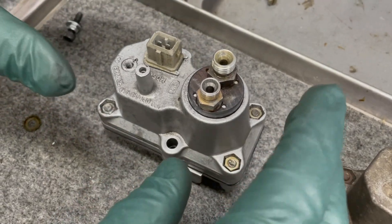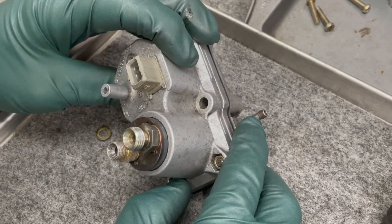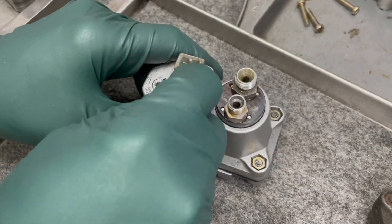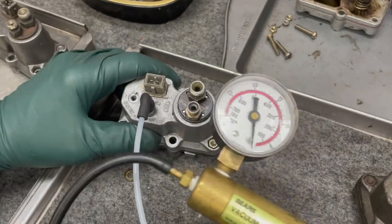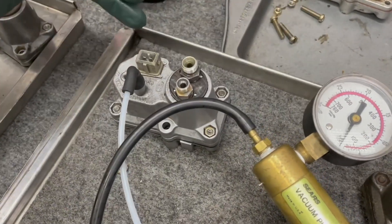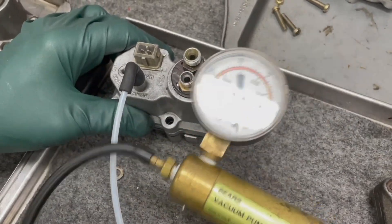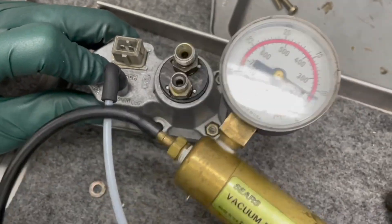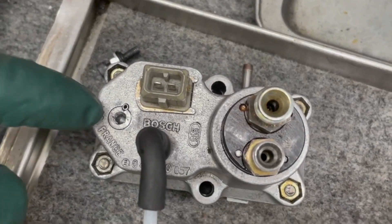My sidekick decided to test this. Remember, in single diaphragm units like you see here, this line down here is to vent and this line here is manifold vacuum. So we applied some manifold vacuum and watched — it's not holding vacuum. That means we've got a leak in this housing, because this should be sealed. We put a new gasket in, everything else is tight, yet it's not building vacuum. We put our finger over this area here and — you've got to be kidding me. I didn't tap all the way through; I only tapped about two-thirds of the way down.